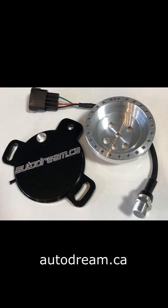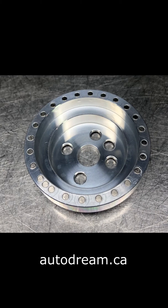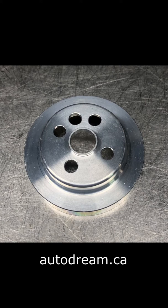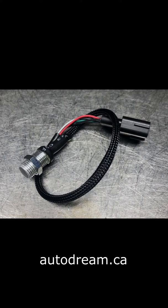When you order the kit it will come in three different components. A rotor that gets bolted to the cam — on the cam you'll see there are four bolts and a dowel pin, and our rotor will have that same pattern so you can line it up. The back of the rotor will have a machined lip so that it centers itself onto the cam gear. There are five holes that you need to line up; one of them is a dowel pin.